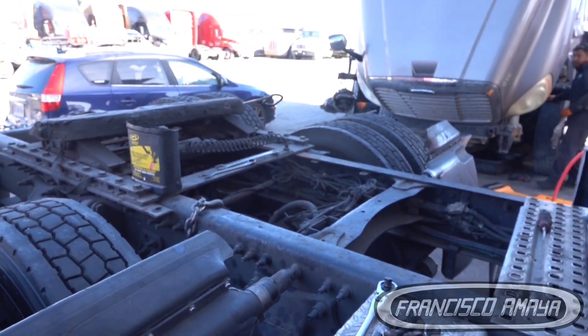We're trying to find the best solution to get this truck back on the road. Any truck — whether you have a Kenworth, Peterbilt, Volvo, International, or Freightliner — they all have the same principle when it comes to differentials. If lubrication doesn't exist on the differential, it's going to go bad. You have to check the differential fluid level at least every 200,000 miles at minimum. Checking the differential every two oil changes would be best.